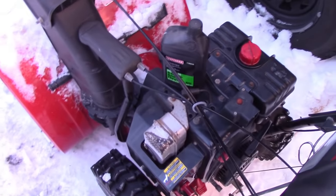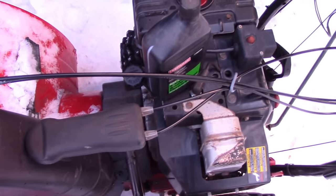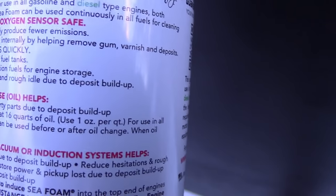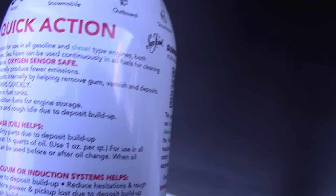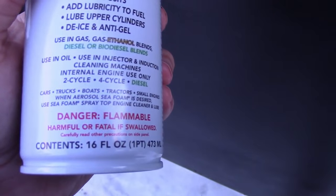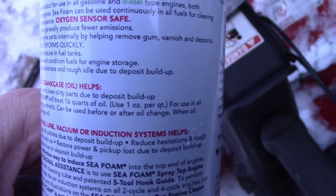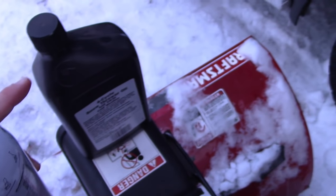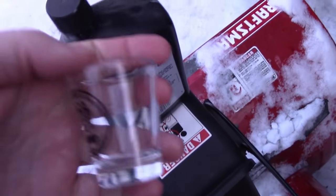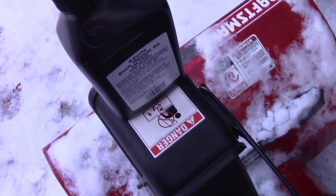I put it back on level ground before adding the oil so I don't get a weird reading — remember to do that. I'm really glad I re-read this before putting it in, because my dyslexia got me. It says one ounce per quart in the oil, and I only put in just over one quart, so I only need one ounce. This bottle is 16 fluid ounces, so that's one sixteenth. If I had a full bottle I'd use an entire shot glass — a liquid ounce — but I'm going to put a half a shot glass in since that's all I have right now.